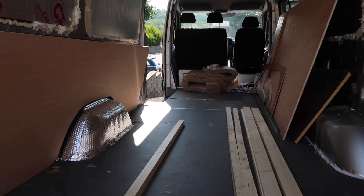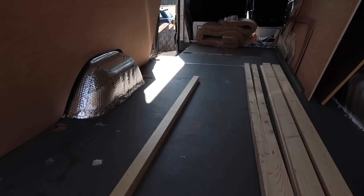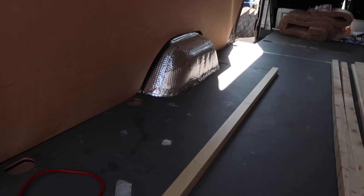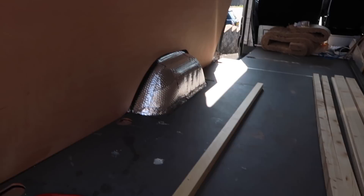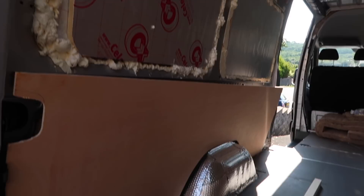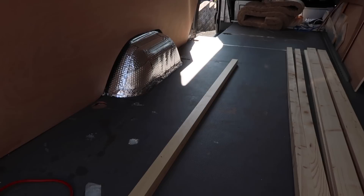The main reason for re-routing is that the 360 amp hour battery is so heavy. Whilst the battery was going on the end here, we're now moving it out because all of that is going to be garage — it's going to be up by the wheel arch, trying to distribute the weight a lot more. The wires coming into this corner were no good as they'd have been going across, down and back across again, which seemed a bit silly. So they're going to be re-routed down that wall. Tonight we're going to undercoat this and a few bits of wood, just sort of prep up.